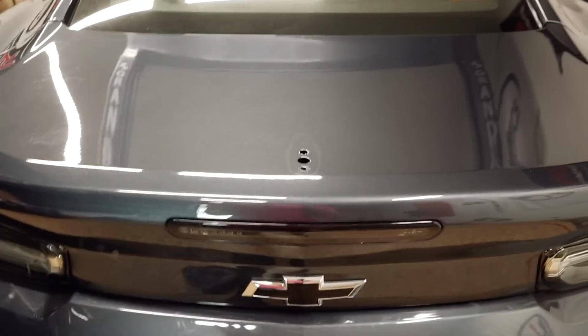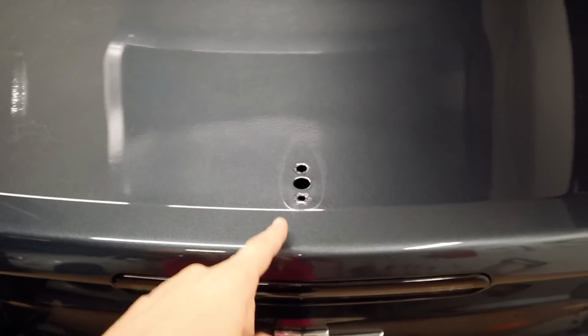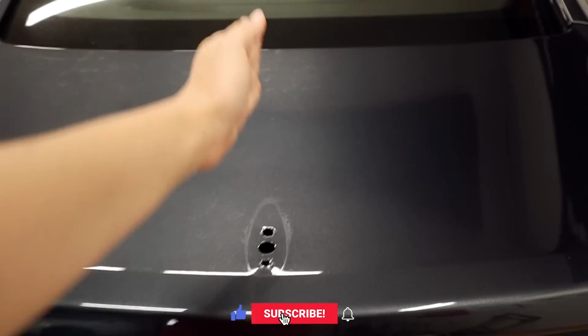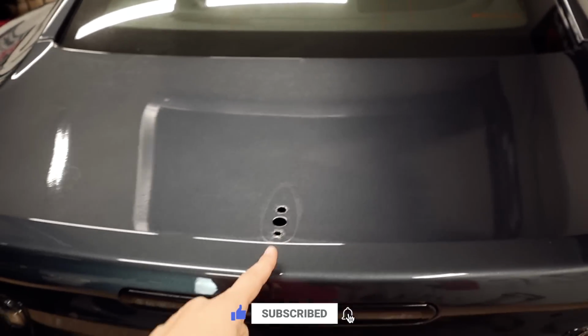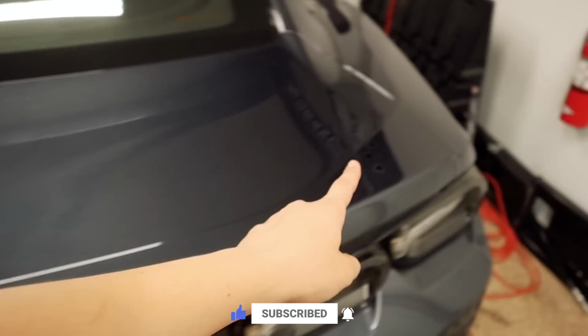This is how it looks without the factory spoiler. So now that it's off, it's time to drill holes. The first thing that we're going to do is draw a straight line here across the trunk, from these factory holes, just a straight line across. And then we need to measure 21 inches to the left and then 21 inches here towards the right.